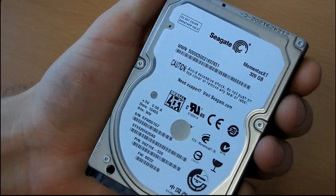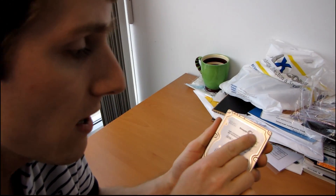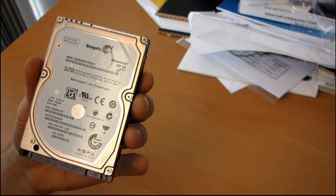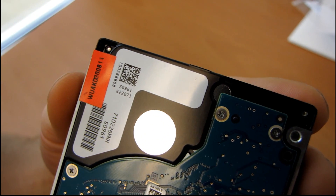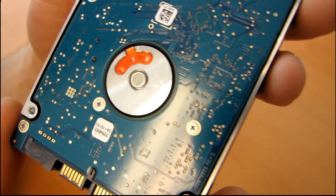To explain how this works: we've had cache on hard drives for a very long time. Cache lets the hard drive take frequently accessed data and put it onto a much faster storage medium, so for quick random reads or writes you don't have to wait for the disk to rotate, the arm to seek, and find that bit of data. An SSD allows us to have a much larger cache. Typically, even on a high-end desktop drive, you're only seeing about 32 to 64 megabytes of cache. Introducing a 4 gigabyte SSD cache — while not as fast as traditional cache — is much bigger and gives much better performance for small random reads and writes versus magnetic storage.